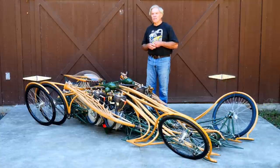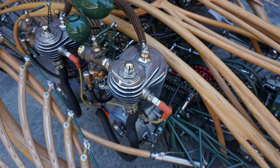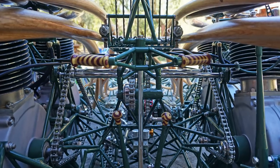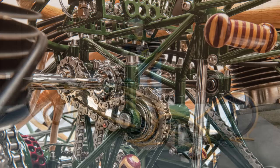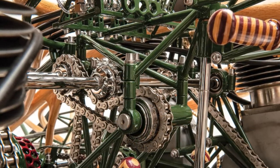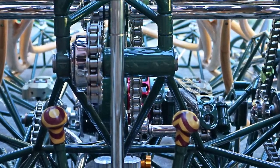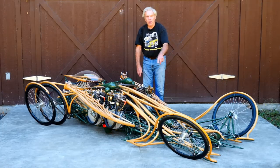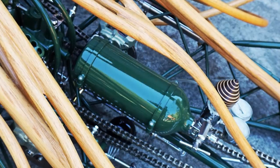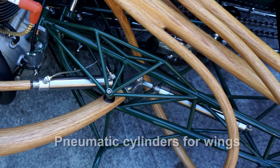The whole idea was to have four motors. These two drive by chain on this side a shaft that goes across with bearings on either end. These two drive a shaft the other way. They're linked with a third sprocket that drives to a jack shaft, then down to a very modified Harley clutch, and eventually into a two-speed Cushman transmission. It has go-kart brakes that are beautiful looking, and a tank that holds compressed nitrogen — two switches, one for each cylinder.